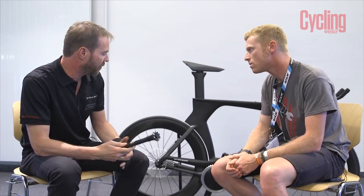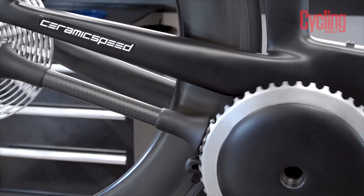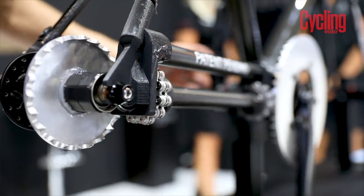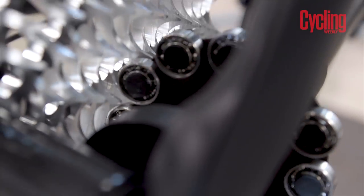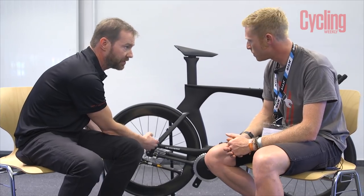From a technical standpoint, what they've done is take the eight points of sliding friction from a chain — the engagement and disengagement points, plus cross-chaining, plus the rear derailleur pulleys — and eliminated all eight points of sliding friction, replacing them with two points of rotating friction. When the teeth engage the bearings, 100% of rider power is put through the bearings radially, so there is absolutely no sliding friction in the system. A servo motor and power meter are integrated, and the rider initiates the shift — the system knows rotational velocity, position, and destination. Within a fraction of a second, the rear pinion moves through one of the five parabolic shift channels and the shift is completed.